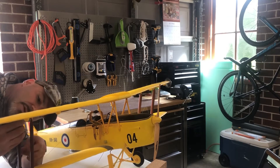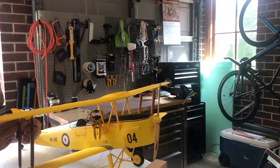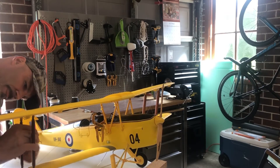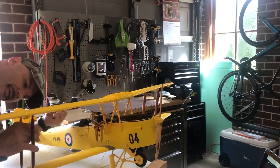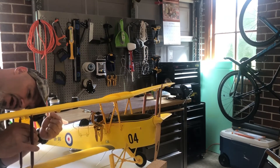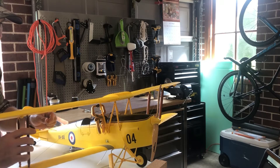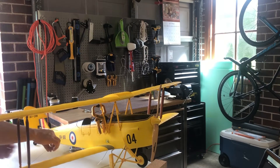We'll run that through there - there's point number three, which is the rear top strut. It keeps getting caught in the aileron - it goes to that one spot every time. First time I routed them it did the same. And then from number three it goes down here - there's point four, right on the airframe, on the fuselage.